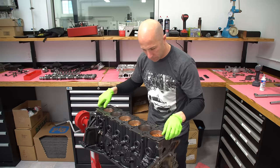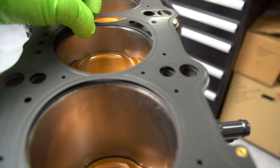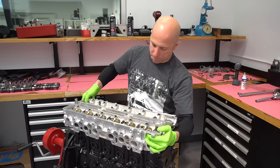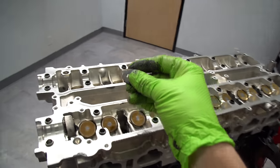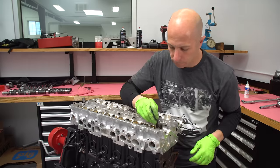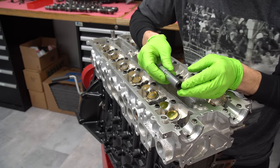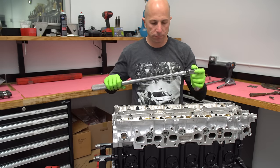Here's the head gasket — it's actually a factory Toyota MLS gasket, called a multi-layer steel. These are really good gaskets from the factory, so we're gonna go ahead and just get a brand new one and use it in this build. Next we're gonna put the cylinder head on. One thing that's funky about assembling these 2JZ engines is you actually can't put the washers on the head with the head studs installed, so you have to put the washers in first, then put the head studs on, then put the nuts on. I pre-lubricated the washers and head studs, and once we put the nuts on we'll torque this up to 85 foot-pounds in a couple of stages — 30 foot-pounds, then 60, then 85.